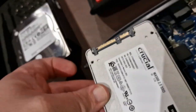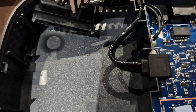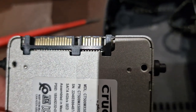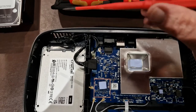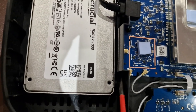It's going to basically go here with the lugs holding it in the retaining clips, what you can just see on the left and right there and left and right at the top. And then that plug, what goes into the hard drive, goes on these pins here. It's as simple as that. So now you can see that I've installed the hard drive by just plugging this plug in and the little plastic lugs are there.